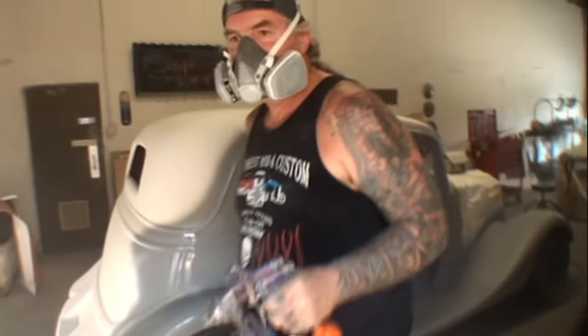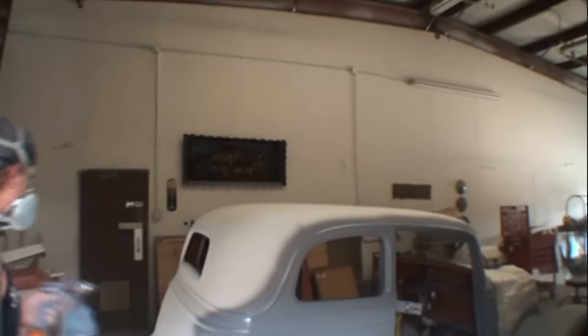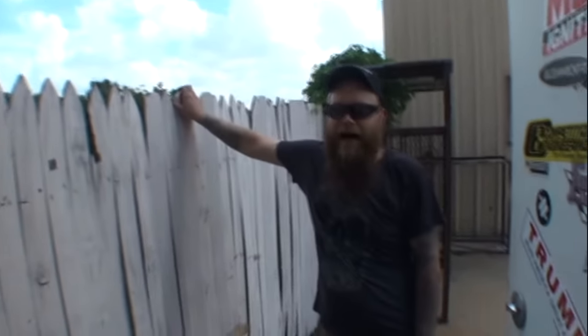What we're doing now, we're priming the car. We gotta get primer on it because the owner messed it all up, getting grease on the thing. The whole thing's full of grease. It's a piece of shit, and we're the ones paying for it. You got a problem with that, Will? Turn that camera on. Get his action on. I agree with you because it sucks that the guy put silicone brake fluid in it. Brake fluid's bad enough, it'll eat paint and make stuff not stick, but silicone synthetic DOT 5 brake fluid is the worst for making stuff stick.